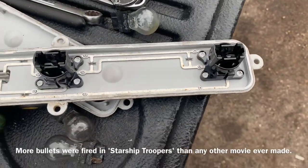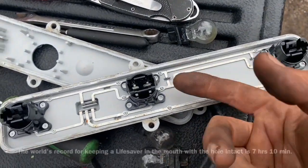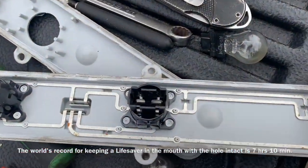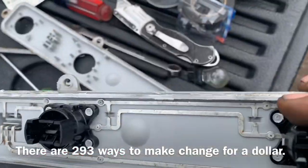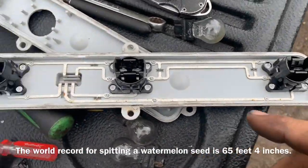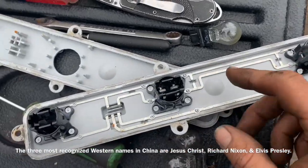The other side was aftermarket, so I took it apart so you guys could see what you might be dealing with. It's pretty much the same thing - these aren't cased wires like the other one, but these are circuits and we want to test them the same way. Make sure you have continuity to each one, look down on the plug heads, make sure they're not corroded, and clean them as necessary. If your circuit board looks like this one, there's not a whole lot you can do because these are plastic-riveted together - inspecting and cleaning it the best you can, or replacing it with a new one, is your only option.